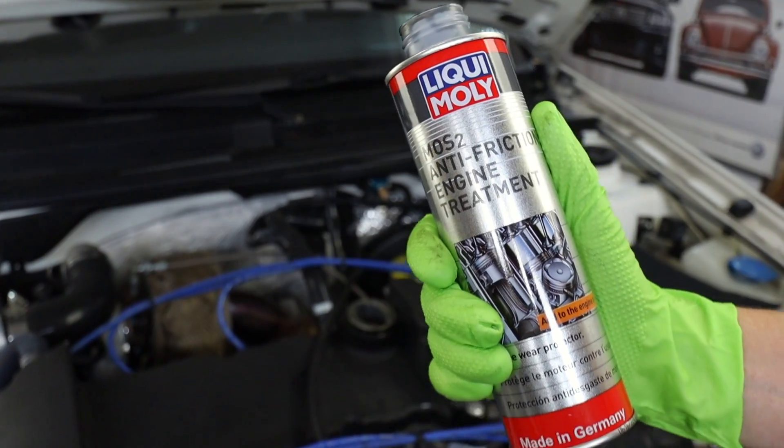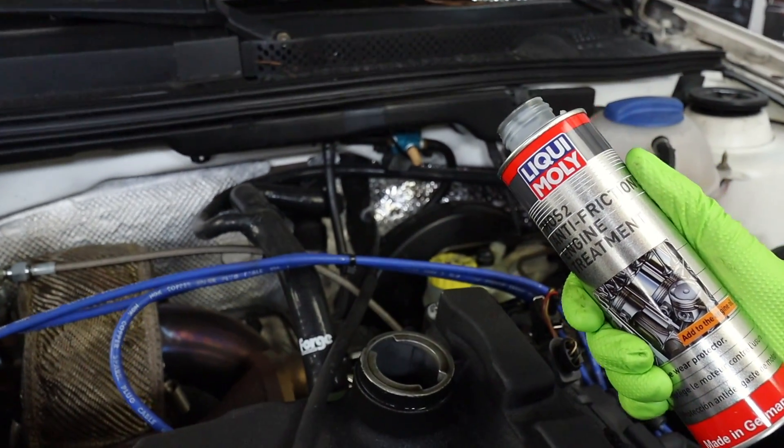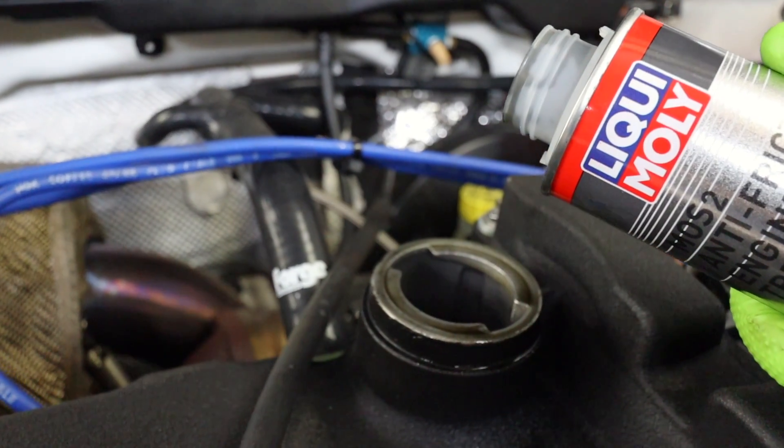In addition to that, I had to do a little bit of maintenance, like an oil change. I actually used the car for some B-roll for another video project, so it had like three times the oil in it that it was really supposed to have. So we got the oil change done, and I figured what an amazing opportunity to figure out what was up with the brakes. My initial thing was to go ahead and check the ABS module for faults — plug the scan tool in, dial up the ABS module, address word 03, and found that I couldn't talk to it.